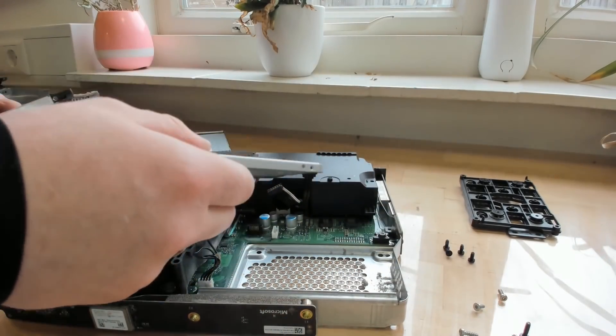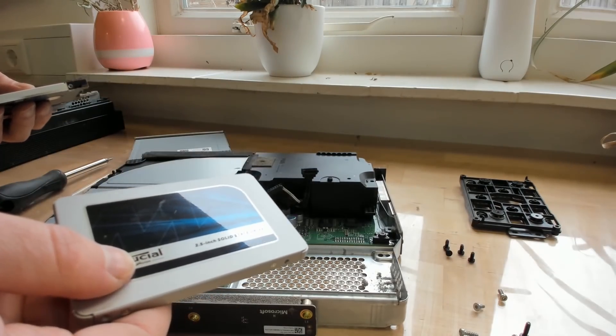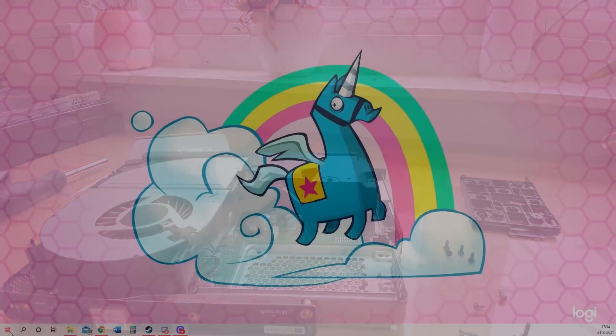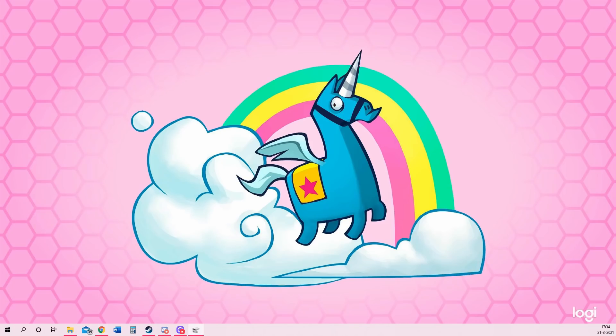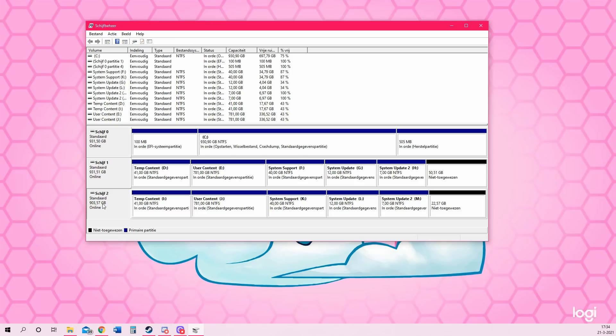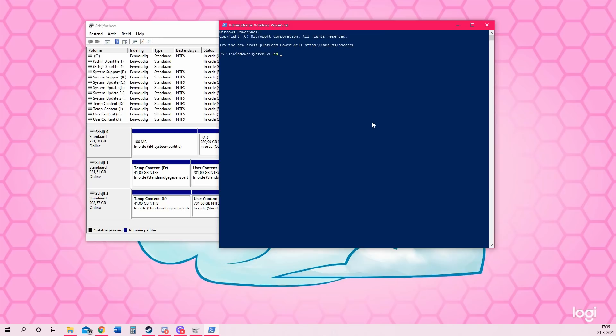For this process, you can hook up both the hard drive and SSD to a computer via either a USB to SATA adapter, or by connecting it directly to a SATA port. Make sure you know which drive is which, because we would not want to accidentally wipe our original drive. I've hooked up both drives to my wife's PC. If the drives are connected, they should show up in the Windows Disk Manager. Drive 0 is the PC's C drive, drive 1 is our SSD, and drive 2 is the original Xbox drive. Xbox HDD Master is a simple tool that copies our entire hard drive to our SSD — I will put a link in the description. After downloading the tool, we open PowerShell in admin mode, navigate to the tool, and start createXboxDrive.bat.